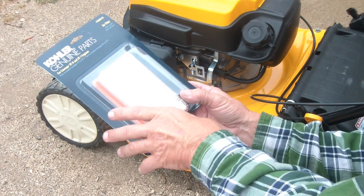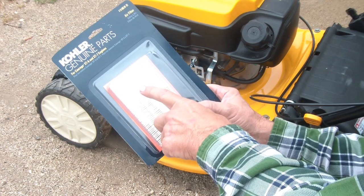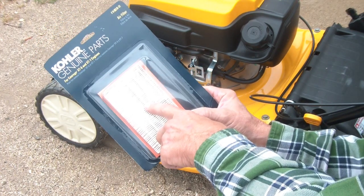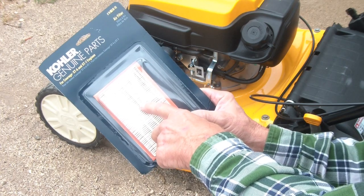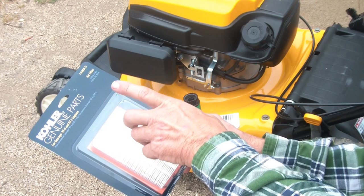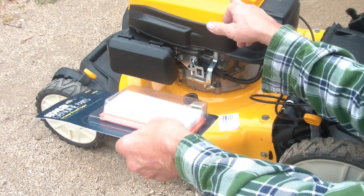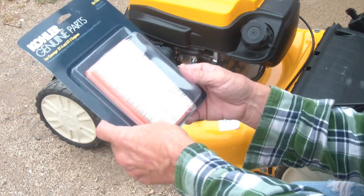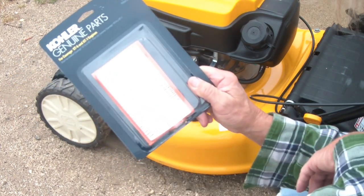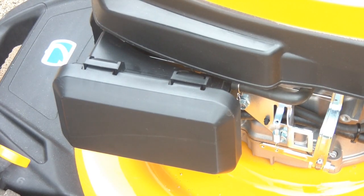To change the air filter, the only thing you're going to need is the air filter. This may not be the filter they require — I ordered one from Home Depot, but on the listing on the back it was only for the 139cc and 179cc engine, not the 159cc. I had to return it. I took the original air filter and found one that matched exactly, so we're going to see if it fits.